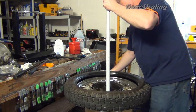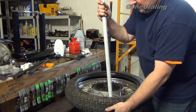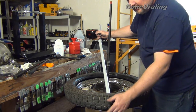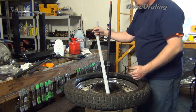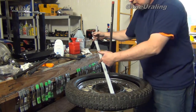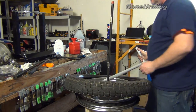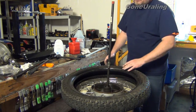Now I'll pull this over and try to get the tool right underneath it. Notice I'm turning it 90 degrees — that's because this tip is flat in one direction, kind of like a hammerhead. When you're about to pull the bead off, you want to turn it so that the long part is this way, and the handle gives you an index to do that. I didn't lube it this time — I should have. Definitely much harder without the lube. Definitely put the lube on — that helps. And the tire's off.